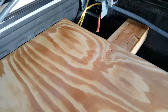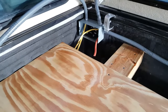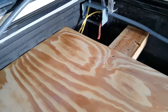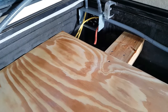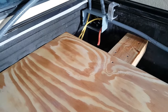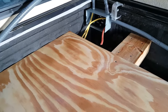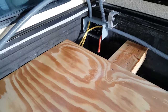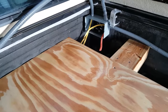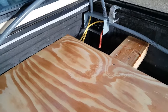I thought that was a pretty good idea. Now this right here — since I made the bed platform, I added that breaker box, and that breaker box is going to interfere with the bed. I don't know whether we're going to relocate it. I thought the box was above the level of the bed platform, but apparently not — I didn't measure correctly. I really want to have a breaker box for these 110 outlets — a service panel inside the camper.